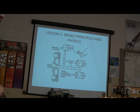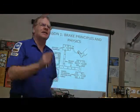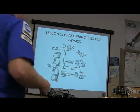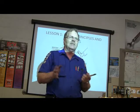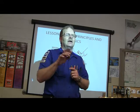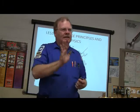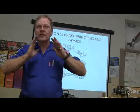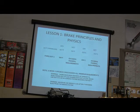And also, something else, let me say while I'm thinking about it, when you're working on rear brakes, make sure that you have them adjusted properly so that they're really, really close to the drum. Here's an example: you can actually put a set of brake shoes on and do everything right as far as putting your springs and mounting the shoes right. But if you don't adjust those shoes out really close to the drum, you're going to have a lousy pedal. You may have to hit it two times to get a good stop out of it. Those brake shoes should actually be just faintly scrubbing the drums, really, really close. And whenever they match the shape of the drum, you got a really nice little deal here.